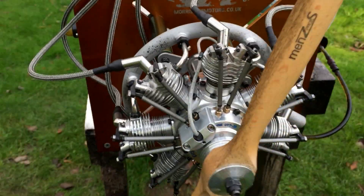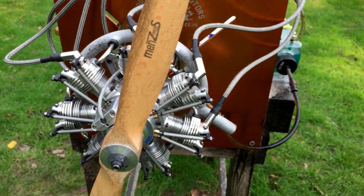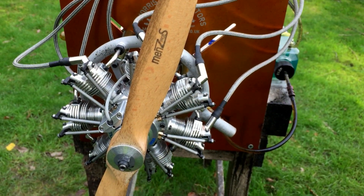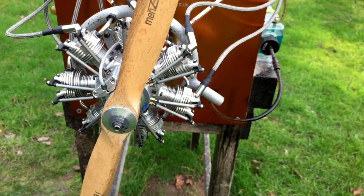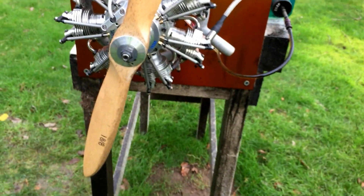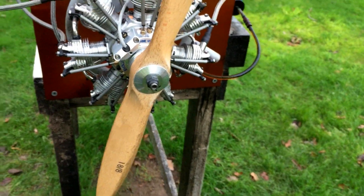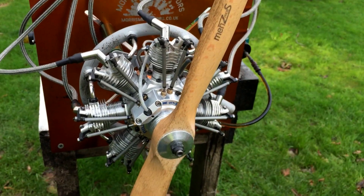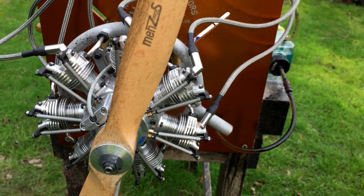I'm sure I have a lot of trust in it. The top RPM I'm seeing with this setup is 6,100, but because the engine is brand new I've kind of reined it back to 5,800 on the top RPM. The prop I'm using is the 18x8. It idles happily around 1,500 until the engine is fully broken in, and then the owner will set it exactly how he wants everything to run — top and low.